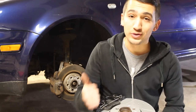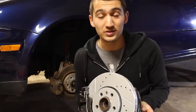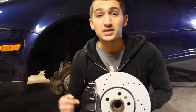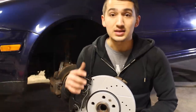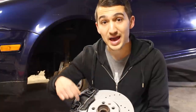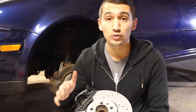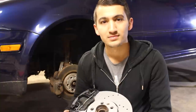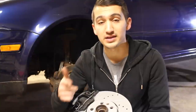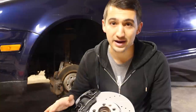You can tell by the brakes behind me they're not only rusted, but they're quite small and they're not going to be doing that great of stopping power. When I swap and install these on the car, I'm going to notice a huge difference in braking performance because of a couple things. Number one, the piston attached inside the caliper is a lot bigger. On top of that, this disc is vented and it's cross drilled and slotted, which is going to make sure that the pad has optimal contact on the brake rotor at all times. The vents are going to keep the disc cooler and the slots are going to shave off a little bit of dirt on the pad every single time it goes over it. The thing that's going to make these brakes stop even better is because this brake is a lot bigger — the rotors don't even compare in size.